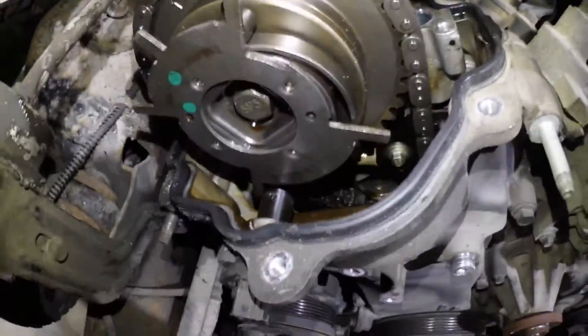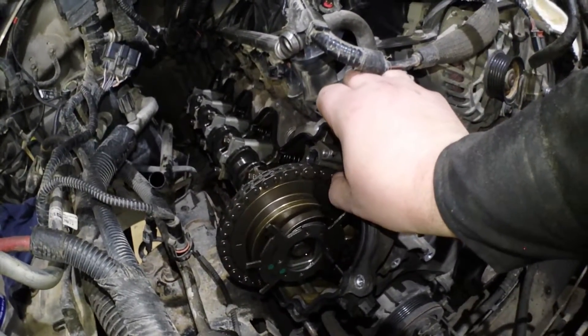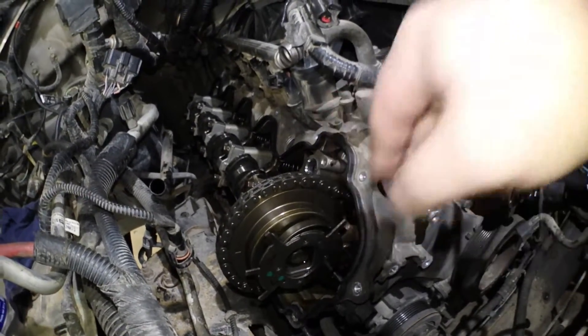This turned out pretty good too — I'm not seeing any scoring, lots of evidence of no oil shortage, that's for sure. Next step, let's do the phasers. I've got to do some vacuuming to get rid of that dirt before we move on to doing the timing. The other side was tight and this side definitely has some play. Removing the driver's side valve cover was definitely a lot easier than the passenger side. Before you remove the valve cover, removing the rubber grommets with all the screws in them would greatly make it easier to pull out, especially if you're not removing the AC hoses. Highly recommend removing the fender skirt. In the next video we're doing the cam phaser lockouts — be sure to watch that one, something interesting happens.